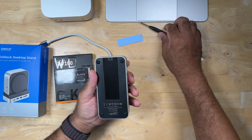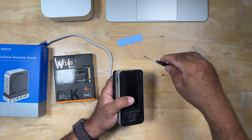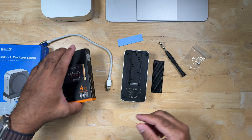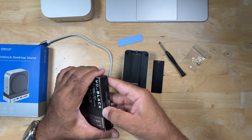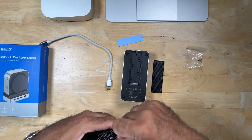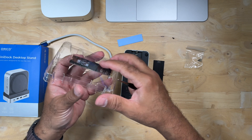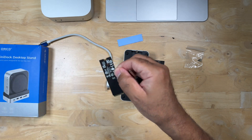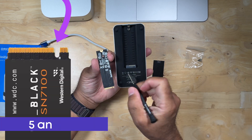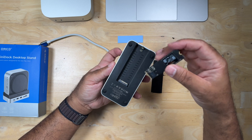Let's get into the install and see how hard it is to set up. Take the little screwdriver, undo the bottom part, try not to lose that screw — and this pops right out. It's very, very simple. Now getting into the Western Digital drive — not at my desk so I'll do some manual package opening. Pop out the old SSD. When you mount something like this, note there are the M.2 mounting positions: the two, a little nubbin, and then the 40.